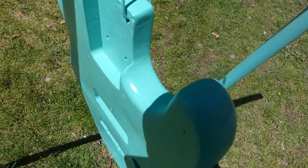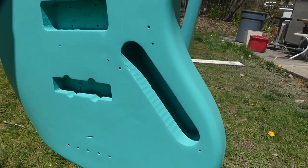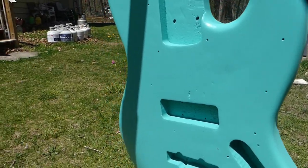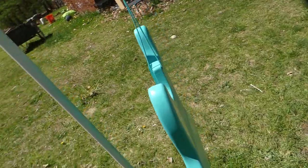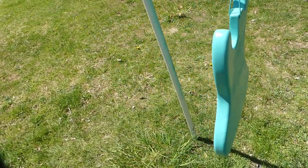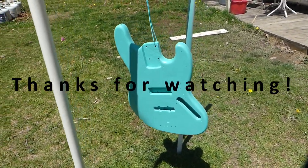Here are a couple of the spots that I hopefully was able to fix where the paint rubs off. I'll give this a wet sanding next time — really fine. I may even just hit it with like a thousand grit so I'm not taking any material off other than the high spots. And then I'll get some clear coat and I'll be back out here to clear coat this whenever that comes in.